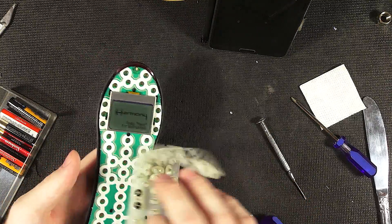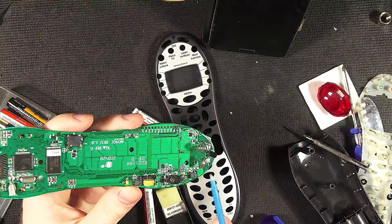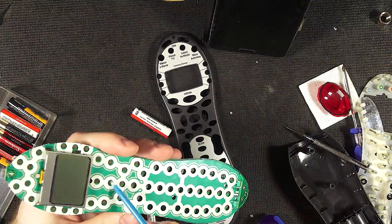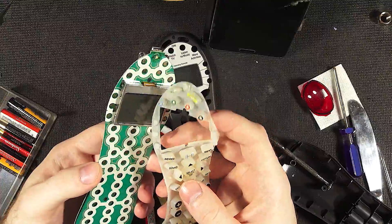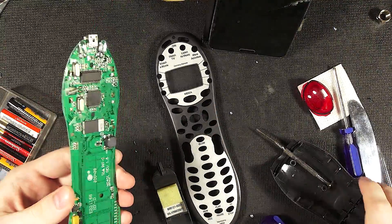Problem is I guess I can't keep enough pressure to push things down. My basic understanding is that some part of this generates a high voltage, or a high frequency mainly, that can drive this electroluminescent stripping. So I'm assuming the white ring parts of this will actually glow, and that's what lights up this. It's a dull effect, but that's what they had to do to get the brightness enough. Another interesting thing to note is that the center button on the pad here is actually glow-in-the-dark — it's the only section that is. They could make the whole remote do that if they wanted, but I guess they wanted to really show off that light button feature. So yeah, that's just a holdover relic from the past, having it be that instead of just a bunch of LEDs.